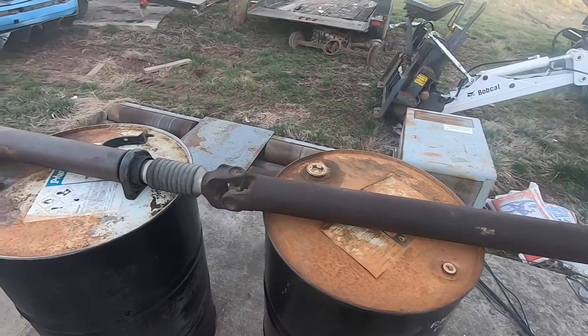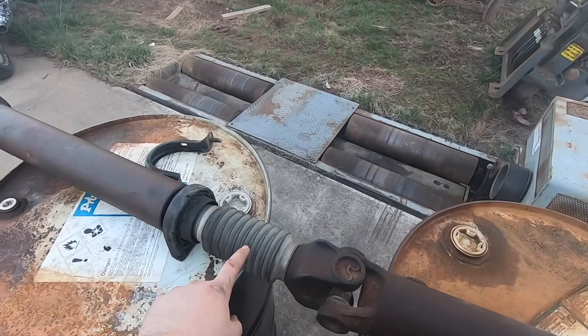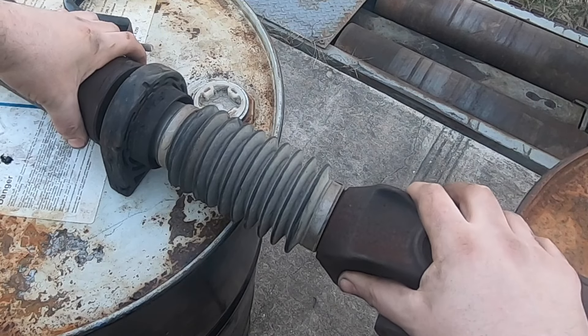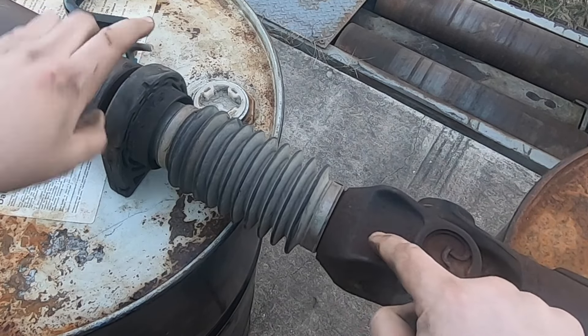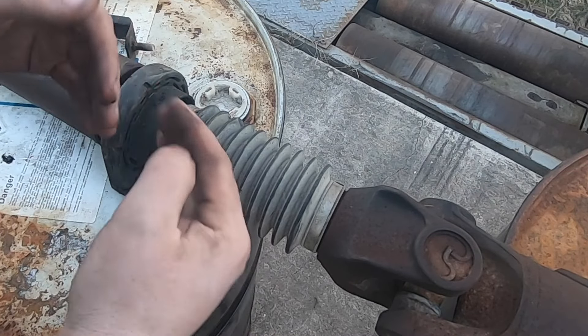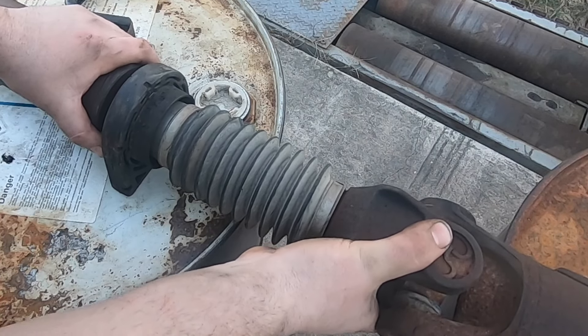So here's the story of how we ended up here. First flaw is the center splines. You can probably hear it — the splines are so sloppy that this yoke will turn a little bit on the midship splines. Especially on a stick shift truck, this thing makes a ton of noise. The splines are worn out, and you also get some radial vibration from this as well.